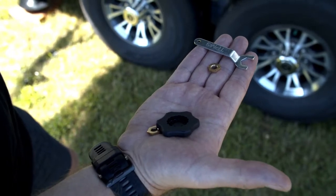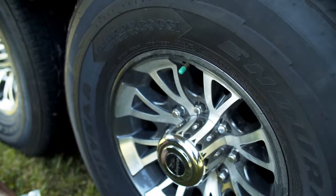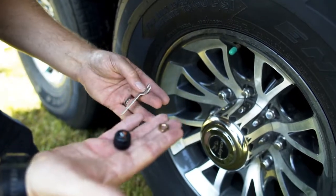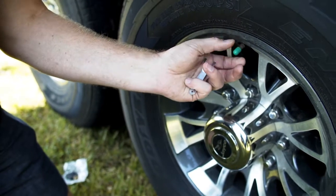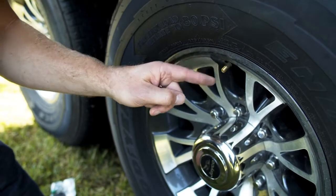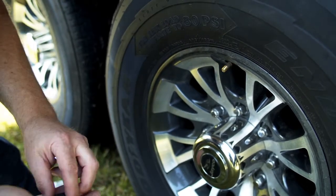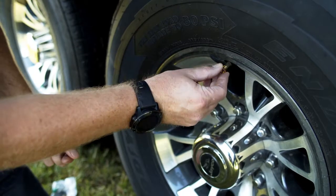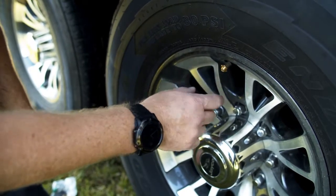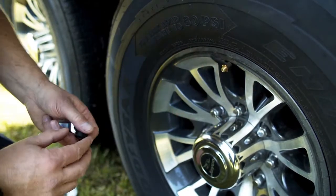For the installation we're going to put our first one on — all we need is these two bits, and a TPMS. Let's zoom in on this big Goodyear wheel on the Jayco and we'll have a look at how we actually attach them. Here we are at our tire, ready to go. Take the little dust cap off there — you want to make sure there's no dust or anything in and around that valve, but normally if they've got a dust cap on they're pretty good.